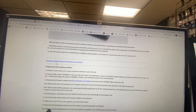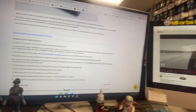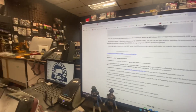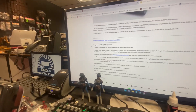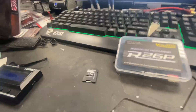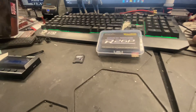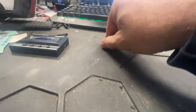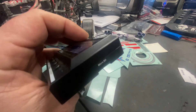There's the firmware update — download this firmware. Then all you do is go onto your PC, go into your Downloads folder, find that firmware file, plug the SD card adapter into your computer or laptop, and then just drag and drop it onto the SD card.